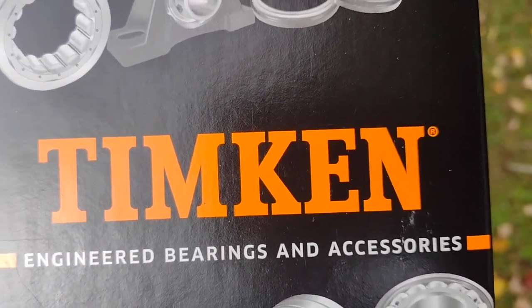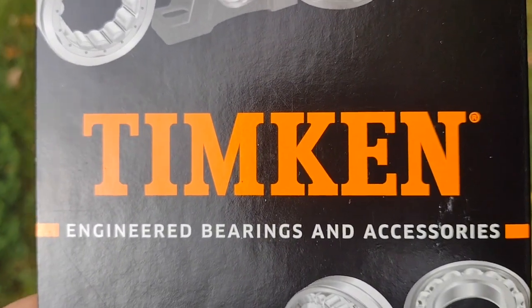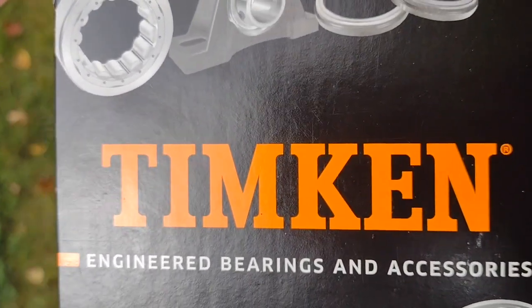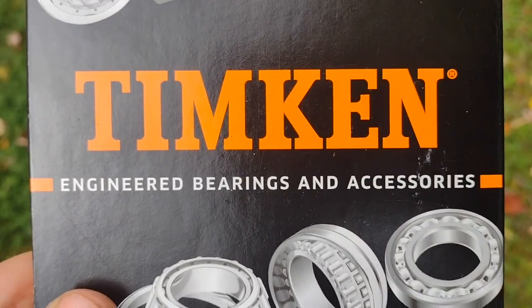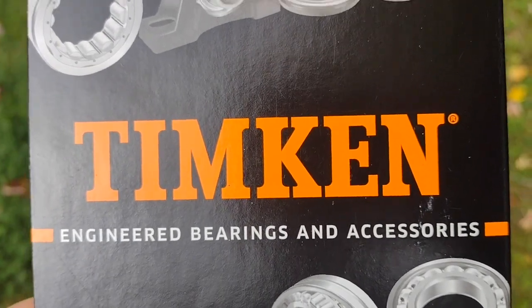Now most of those can't be done for that price, but repacking wheel bearings on a two-wheel drive pickup is one of the last $20 procedures you can do. I'm sure there are exceptions, but overall, it's one of the last cheap procedures there is. It's probably the single most overlooked bit of maintenance on anything like that. So that's your tech tip of the day.